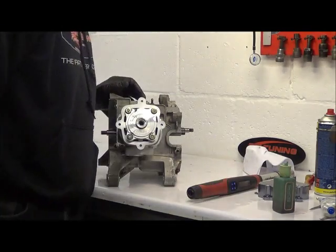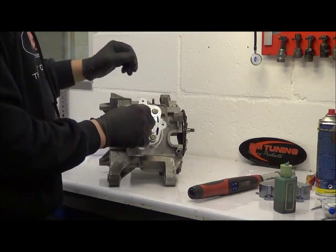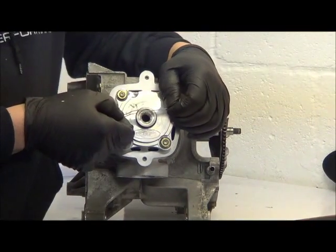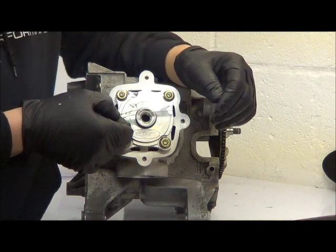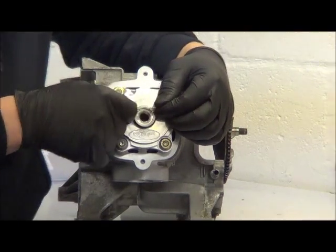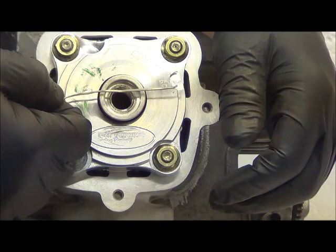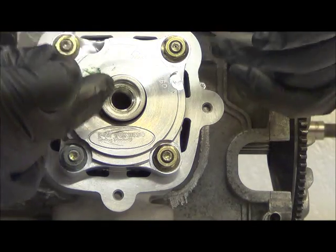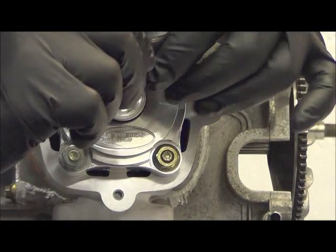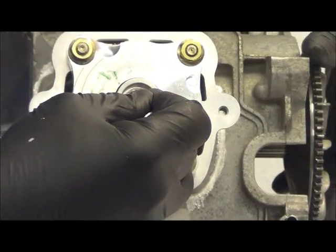In the next video we're going to show you how to check the squish clearance. There are two ways to do this: one is to bend the solder at ninety degrees and pop it down through the spark plug hole; the other is to lay a straight piece of solder across the top of the piston before you put the head on and dab it in the middle with a piece of blue tack. The idea is that if you do it the internal way you'll get a much more accurate reading because you don't get any piston rock, and it will contact exactly the same two points — though the clearances will read smaller doing it that way.